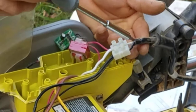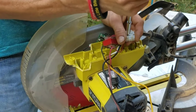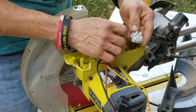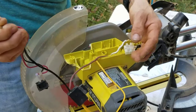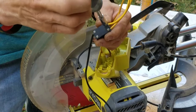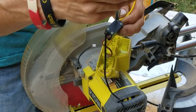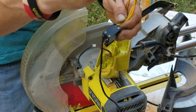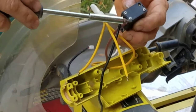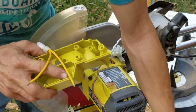Let's see if we can do this without taking these out — it doesn't look like these need to be taken out because they'll still be hooked up, but these wires need to go down through that hole so I definitely need to pull those out. Looks like you just pull it out like that, so remember the black goes on the right side with the black and the white and the red goes in there. In order for this thing to pass through, my best bet is probably to take this yellow apart. Perfect — this one needs a little more. Keep my hand on that one so I know it goes on that side. That's that one. We know the one with the writing on it goes on that side and then the pink one's going to go on this side. That should be all I have to take loose to get it through the hole.